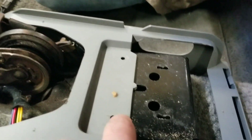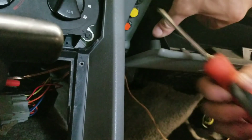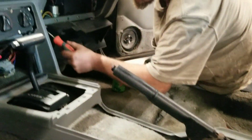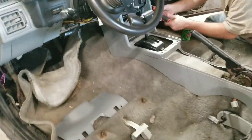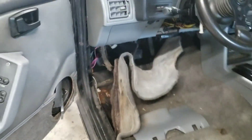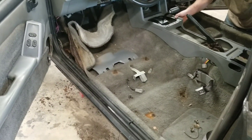After that there are two more Phillips screws — one here and one here — and then these ones here behind this panel. Push in on this side just like that, pull those two out, and then we'll be pulling this out. After that we'll go ahead and strip this carpet out so we can get in here and take a look at the rust a little better. I pulled it back just a little bit and you can see it's definitely through there, so he's gonna need a partial pan. That's why we're here.